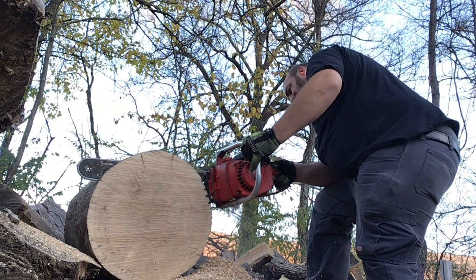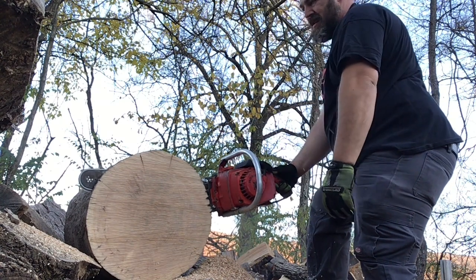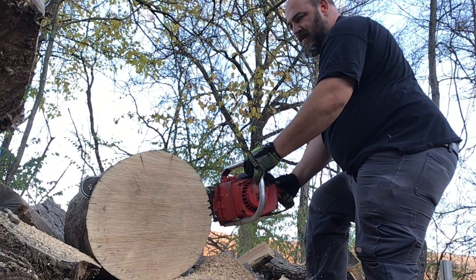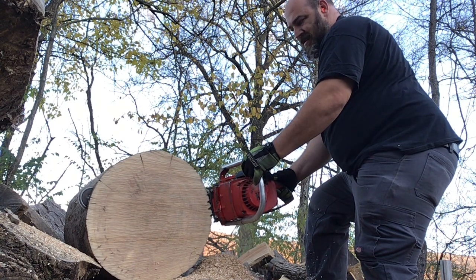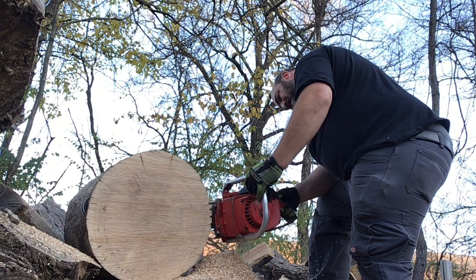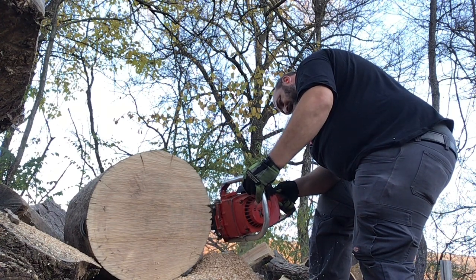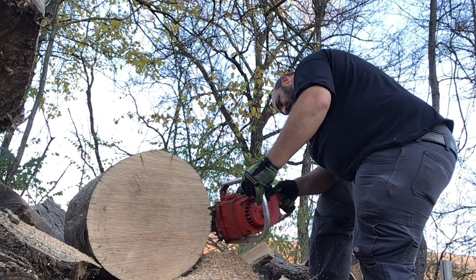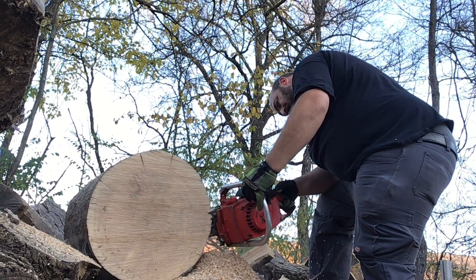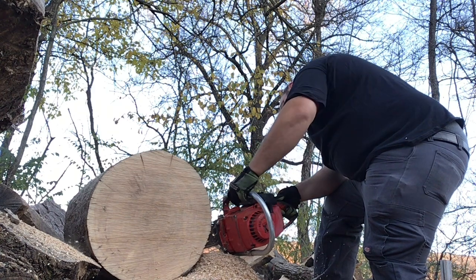Watch my hand on the handlebar - I'm going to test it and see how easily it goes into four-stroking. One thing I want to point out is I'm running this Super XL with a 20-inch bar, and throughout the entire cut we're not seeing the RPMs drop. So I've definitely increased the torque of this saw without a doubt. A normal Super XL Auto would definitely lose RPM in this kind of cut, and this one is managing to maintain RPMs throughout the length of the cut. We definitely got our torque boosted, just like I was hoping.